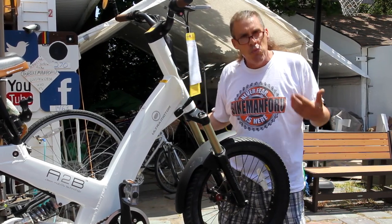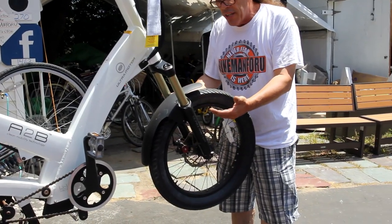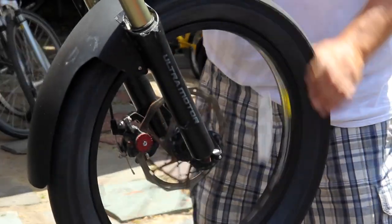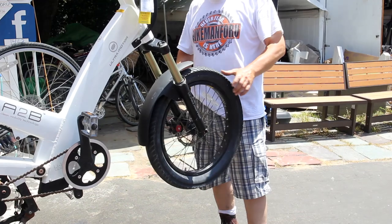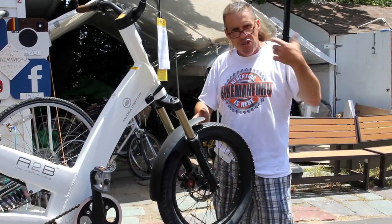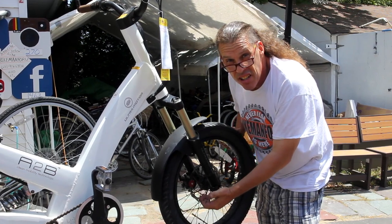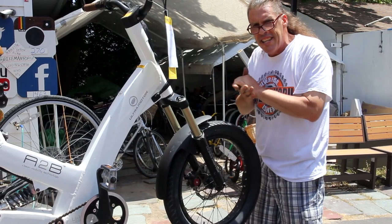The first thing we like to do here in the shop to help seat the tire is to put the wheel into the bike, so that way when I air it up I can spin it and look at it accordingly. But if it keeps bulging off in one spot — it bulges off — well, if it bulges off in one spot it's got to be sucking in in another. It's pretty simple on how to take care of this.